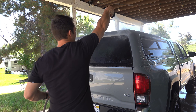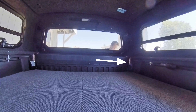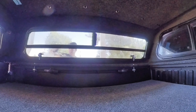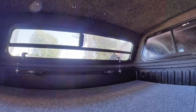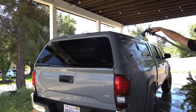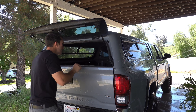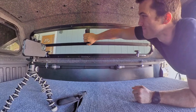First I'm starting off with a basic shower setting. I knew the portion between the tailgate and taillights were the most vulnerable, so you can see I spent some time spraying both sides — and you can actually see a small amount of water get in on both sides. The side window I didn't know was cracked, but a small amount of water gets in there. You have to make sure they're really closed. Spraying directly into the cracked window, surprisingly only a small amount of water actually ended up getting in.